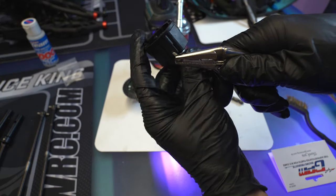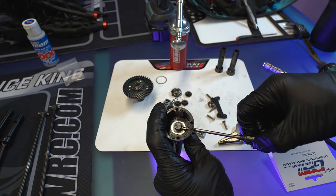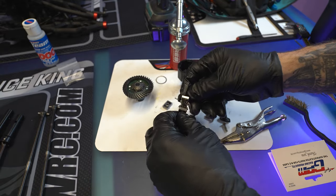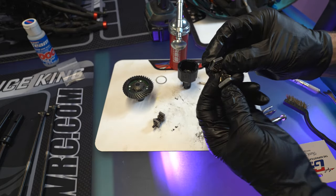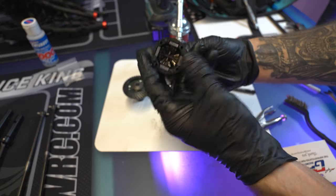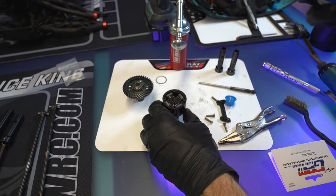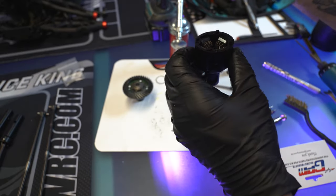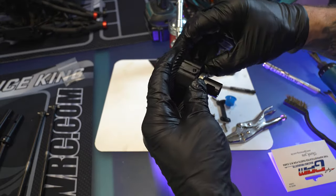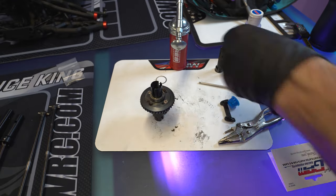All right, I'll slow down here. This is where you stick your pin back in. Nothing there, just to come up above the cross rings in there, you'd be good to go. Nice fresh rebuilt diff. Don't forget to reinsert your screw. Screw comes off, just swing it back on, and put it down with some putty.